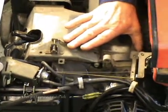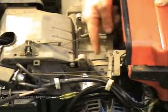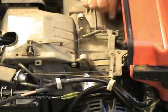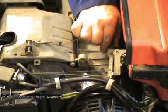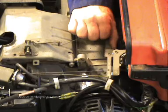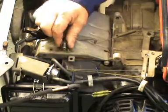So the engine speeds up and the governor tries to press it that way. The governor's spring is working against it — it's trying to pull the carburetor throttle butterfly open by pulling the governor arm the other way. So that's shutting the carburetor down, and that's opening it up. When the machine's at idle, the only force operating is the governor's spring, so the carburetor is fully open. The two forces are balanced when the machine's running to keep it at about 3000 RPM, and the balancing is done by this screw here, which you use to set your engine speed.